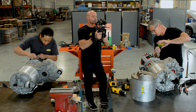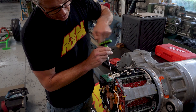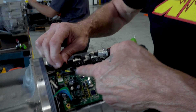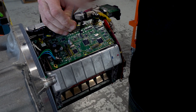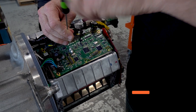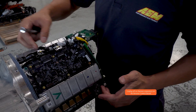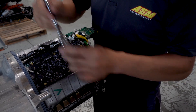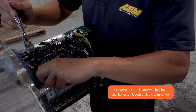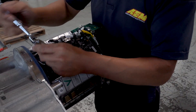It's all straightforward. Little tiny clips that need to slide out really easily. There's some sealant or low-grade thread locker on all these small Torx drives. Start off by taking all the connectors off by releasing the locking tabs and pulling. Then loosen the two middle Torx screws first, then completely remove the outer four. This will let the board stay on the backing plate, and then you take it off the backing plate once you remove the entire assembly with the backing plate still attached.